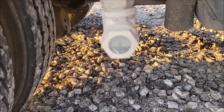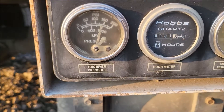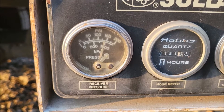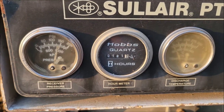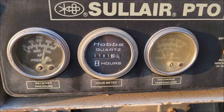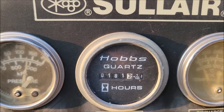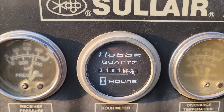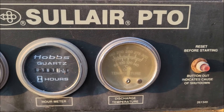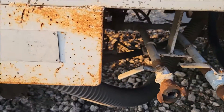I've got good oil level. It is at about 140 PSI. The hour gauge, although it's hard to tell, is moving very slowly. Watch close — see there's a little white line. That's the temperature gauge. I just turned it on so it's not going to be hot yet. Let's sit and see if we've got any air coming out.